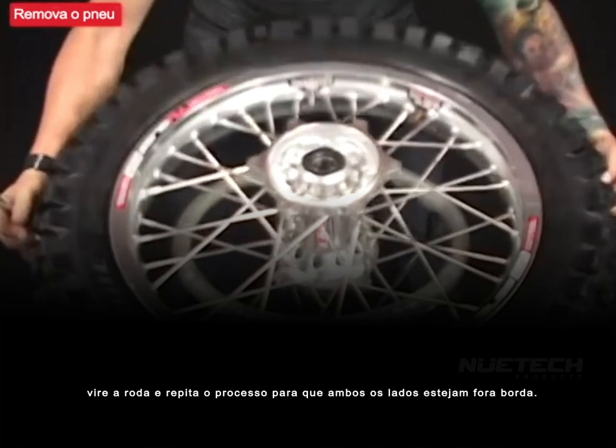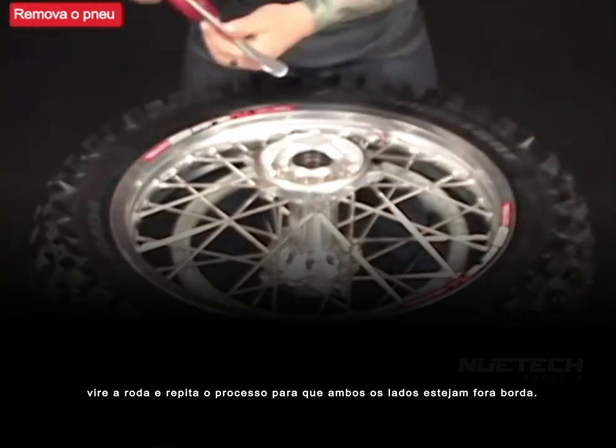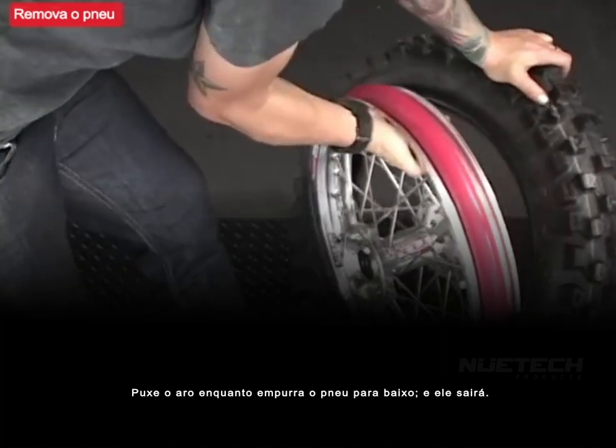Flip the wheel over and repeat the process so both beads are off the rim. Pull on the rim while pushing down on the tire and it should come right out.